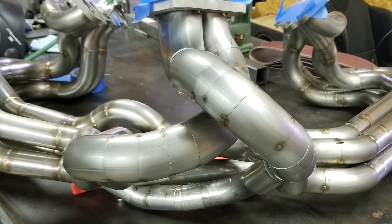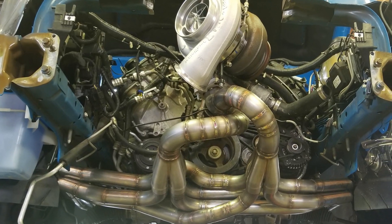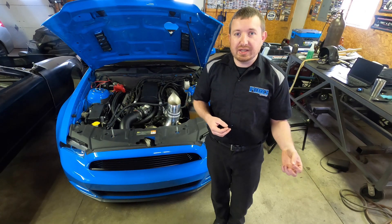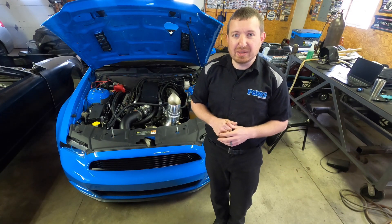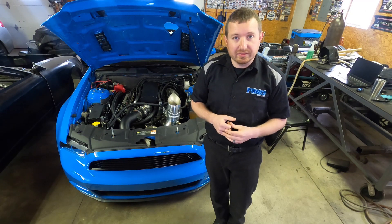You can see the header — there are a couple of issues with it. The primary tube length is obviously longer than ideal, and the header is just heavy — I bet the thing weighs 50-60 pounds. It is all thin-wall 304 stainless, but it is still very heavy.